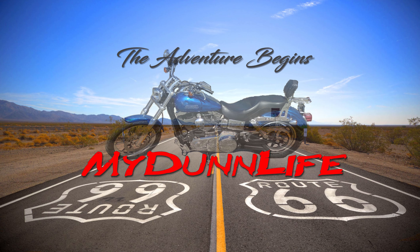I put some non-ethanol fuel in it, which is what I'm running right now. And then I still put some stabilizer in it as a secondary precaution — especially with this bike being fuel injected, I don't want to have any issues in that category.